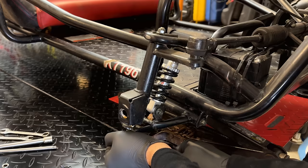And the other wire goes to the ignition coil. Now, if I wanted to wire the same thing for the electric start, I'd put battery positive in the middle, and instead, I want the connection to be made when I hit start. So I'd connect another wire right there, which would go to the starter solenoid. In this case, Generac just used one side of the switch. The middle side is a source of ground, I believe. So when you turn it off, that will kill the ignition coil. And when you hit start, it'll send the ground to the starter solenoid. At least that's my belief.